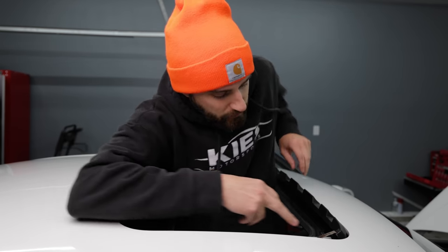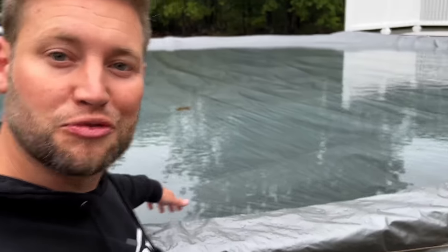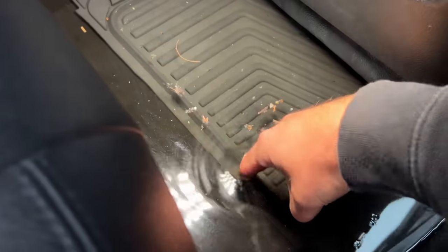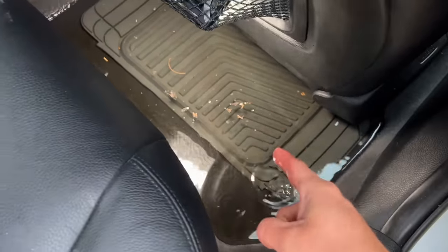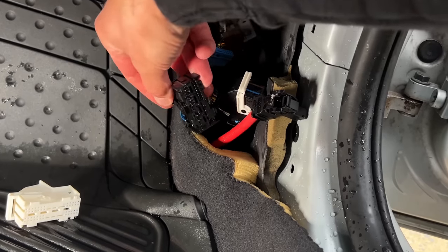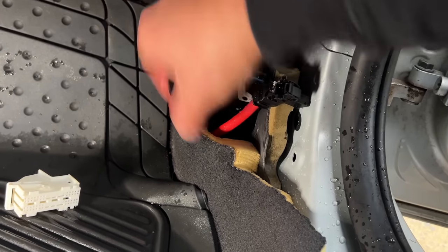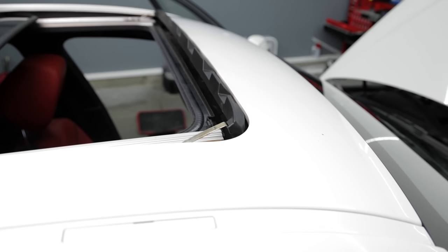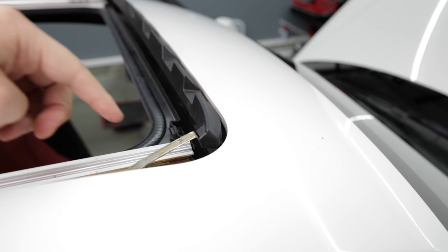If your car has a sunroof, you want to clean out your sunroof drains — there's one on either side on the F30, and you're supposed to clean these out periodically so they don't get clogged. My friend Brian has the same car, and about a year ago his drains were all clogged up. He ended up with two inches of standing water inside the car, and the damage it did probably would have totaled the car — but of course it's Brian, and he used the opportunity to swap the interior. You don't want to go through all that, so clean out your drains.